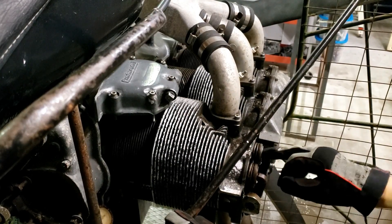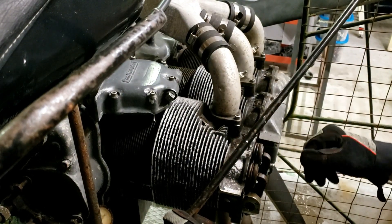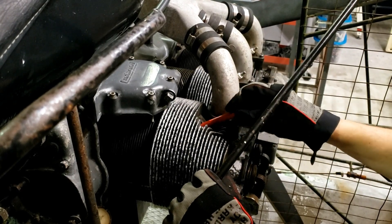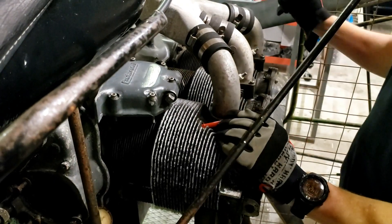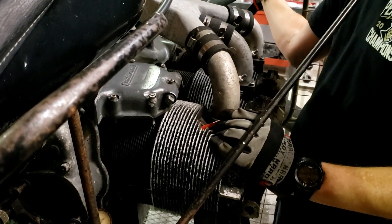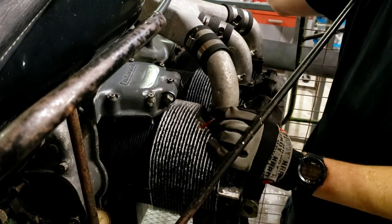I got some pressure but wanted to make sure, so I verified it with the intake valve. While it's in the compression stroke, the intake valve moved. Just after what I felt was top dead center, the exhaust valve opened up. Once you verify you're in the compression stroke, you can put something soft — wooden or plastic — in here to verify where the piston is. Right there is top dead center; you can feel it go back and forth.